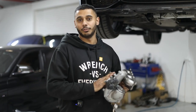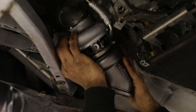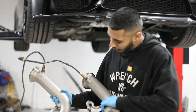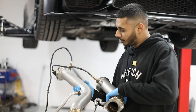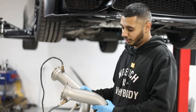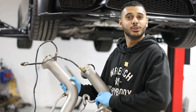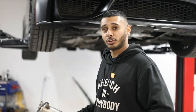This is the rear turbo — I've already fitted the front turbo. The fitting process is the same as removal but in reverse, so let's go ahead and fit this one and then we're pretty much complete. Here we've got the S55 ceramic coated downpipes. These come with a flex section to avoid the vibration of solid ones, they help keep everything around them cool so nothing melts, and they just look cool because they're ceramic coated. We're going to fit these, put the exhaust back on, and we are pretty much done.